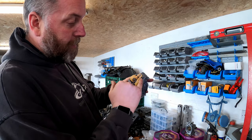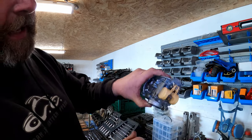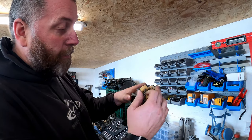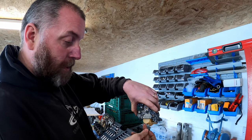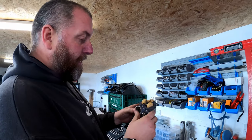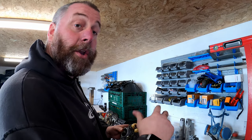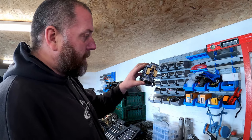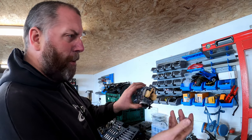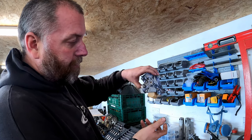The float assembly is all fitted, all the jets are in and everything is screwed down. There's a retaining screw for the little pin for the float. The valve just hangs on this little tang here and it's free to move up and down — that's what it does, it stops the fuel coming in. But that float height has to be set absolutely right; if it's too high then too much fuel will enter, if it's too low then not enough fuel.